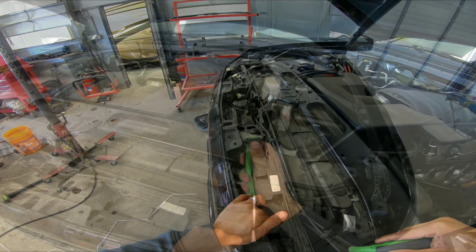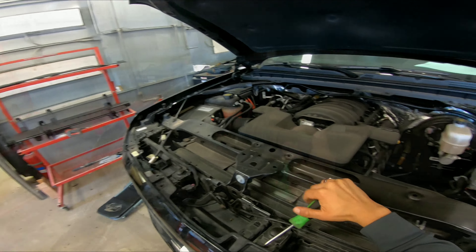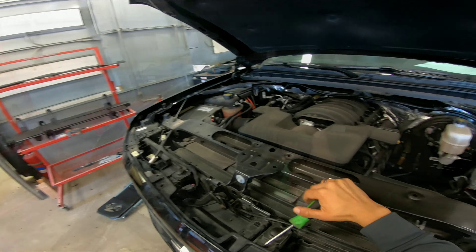As you can see in the next clip, the grille has a little guide that goes in between the radiator support and the grille, which you have to pry and wedge apart so you can remove the grille. I remove that part and leave my panel clip removal tool wedged there, then grab my other one and leave that wedged too, and start removing the other two sides. If you don't keep it wedged, it'll slide back into place by itself. Then you just pull firmly on the grille and it comes right off — it has a pressure-clip setup, there are no bolts behind it.